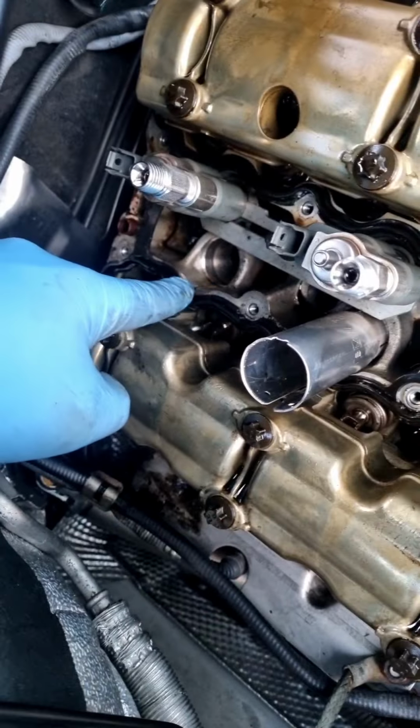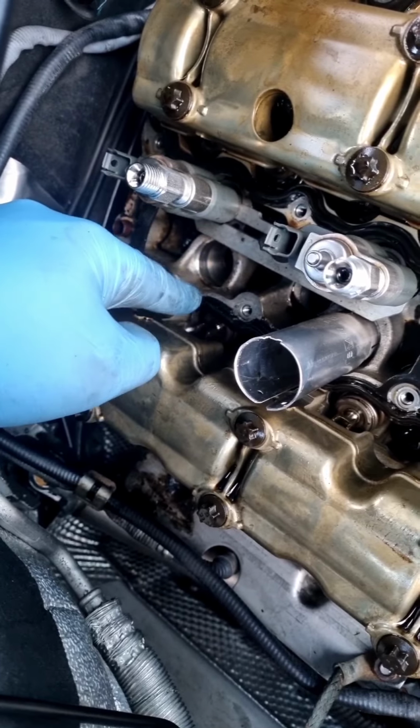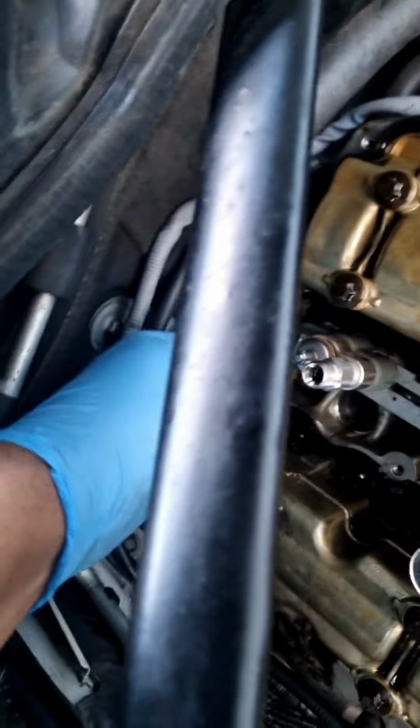But so the culprit is, it's leaking out the back. So you see that rubber here, it's solid hard. So obviously the oil has been seeping into the spark plug. Even in the back of it, I've noticed there's oil leak, so it's all gone rock hard. So that could be the cause of oil leaks. So happy days, get two jobs done in one.